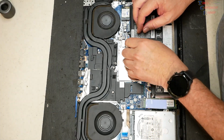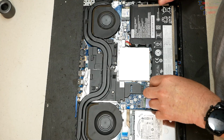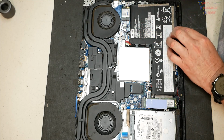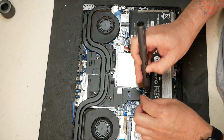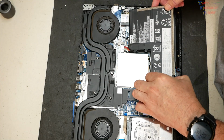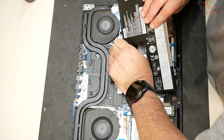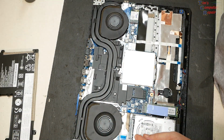Okay, the very first thing we should do is remove this battery. Unplug the battery. In this case, it's a little tough to remove that because of the cables. So I'm going to go ahead and take off the screws that mount the battery itself. Okay, 4 screws. Hopefully just kind of lift this out, and this will give us, there's 5 screws actually, sorry about that. There we go. Now we're safe to work on this board.